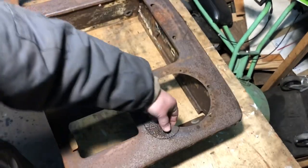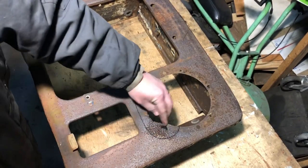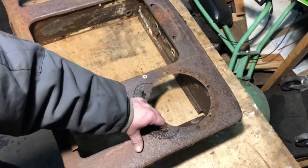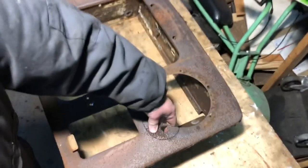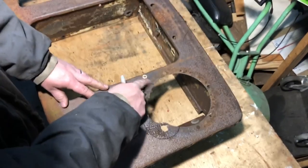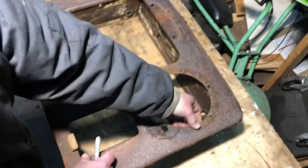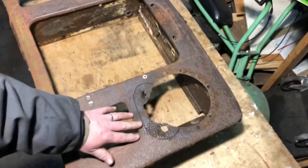As I can tell, whenever I'm feeling the metal here this is feeling pretty thick out here, but this is thin right here. As you go in you can kind of feel with your thumb that you can bend this down, and you feel it getting thicker - like it feels thick out here, it's not moving around. So I'm thinking this might be a good cut line to make a patch go around there, because this is still pretty thick right here too. I'm going to cut this out here.